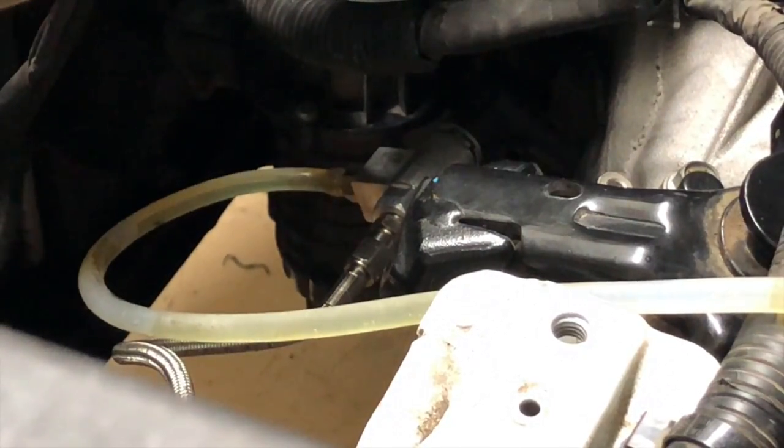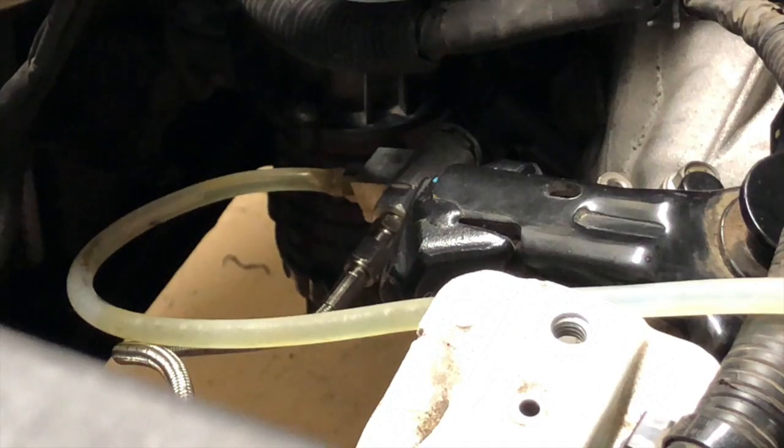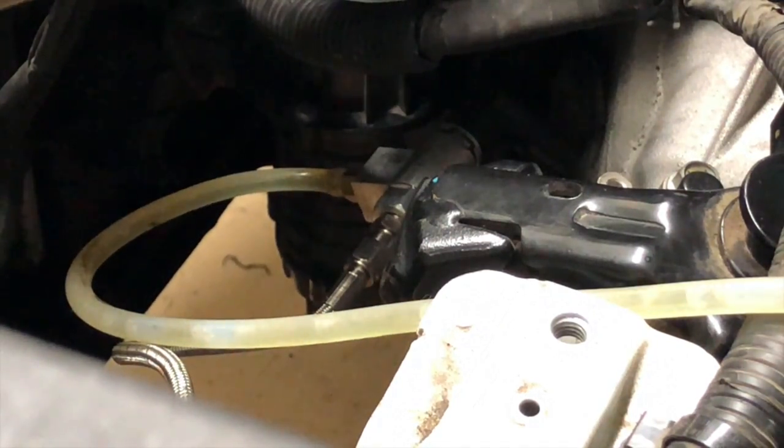With the clutch here, when you push it in, it's gonna hit the floor, right? So you just gotta pull it back up, push it, pull it back up. And then I keep doing that. And it'll get harder. Now, while you're doing that, this line, see, it's got air coming out of it. I can feel it here. Feel the air?